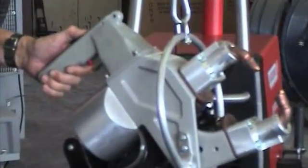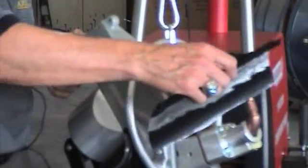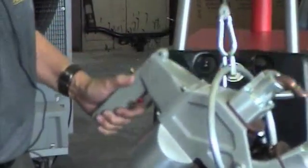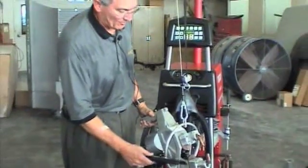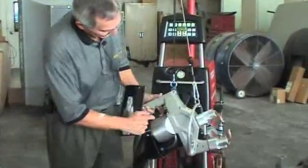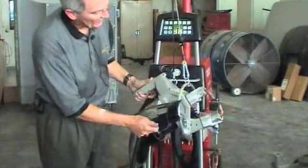What we're going to do is make this a 3-step process where we're first going to squeeze, then initiate the current here, weld, and we're going to hold for 3 seconds until the beep on the machine stops to form the weld and let the weld cool while it's still under pressure.